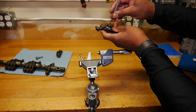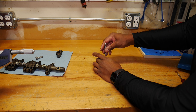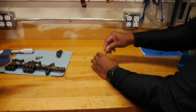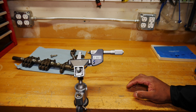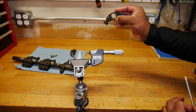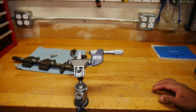We also need to flip the gauge around to check for ovality. I flip it, take the tension off, and re-measure. It comes back to 0.78820 — about the same. This rocker arm appears nice and round. We'd want to measure the bottom side and top side just to be sure, but I'm not really worried about the rocker assemblies. I figured while I have the engine open I might as well do as many checks as possible before putting it all back together.